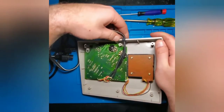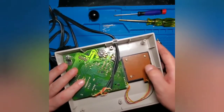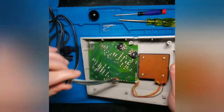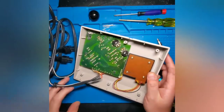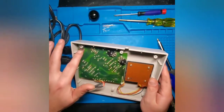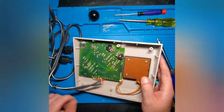Now that we have the six screws out, the bottom plate just falls right out — we'll set that off to the side. Underneath is the main board for the buttons and also the board for the joystick. There's a clip where the wire goes into the back, and we have six screws that hold the button board in.